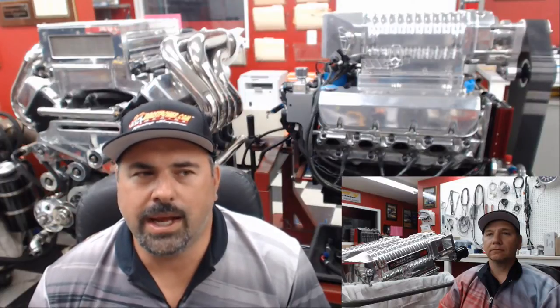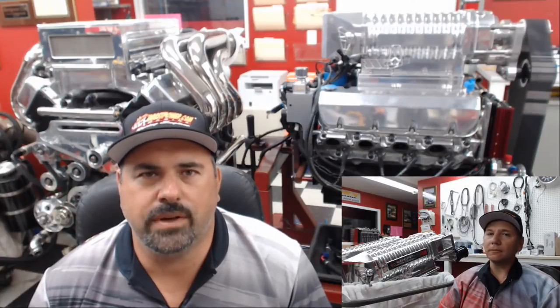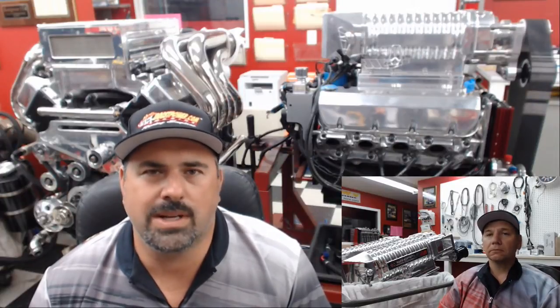Keep in mind what your climate is and talk to your local service center or engine builder — let them suggest what to do. The main thing is water freezes and engines don't like to sit in one place; the seals will develop spots where they'll leak when you start them up. Try to rotate your engines every so often. And if it's a real high-performance engine, loosen the valve covers, take them off, and loosen all your rocker arms or get all the pressure off the valve springs — because you don't want a saggy valve spring, that could cause a disaster.